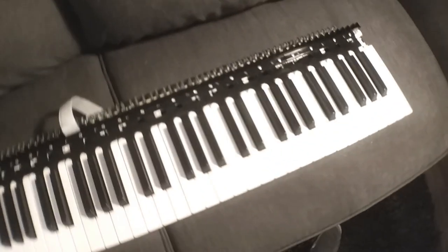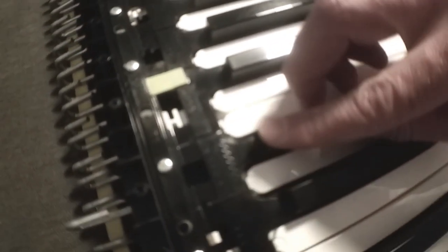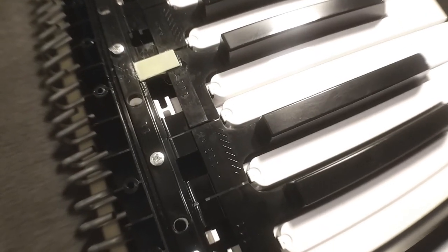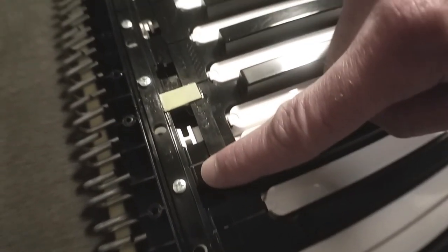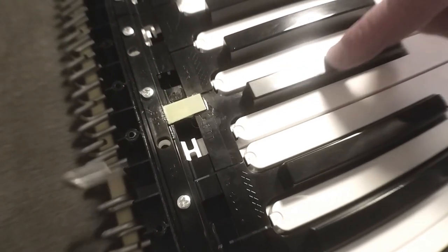There you can see that's one of the previous fixes. We're going to get this back in focus in just a couple seconds. So let's have a look at the hinge here. It's just a soft hinge — just an entire plastic unit. The plastic is a little bit thinner there, and that's why the key bends. The very nature of the hinge is that it will fail because you're constantly bending the plastic. I'm going to come back to that fix because I actually made a mistake on it — we'll look at that in a second.